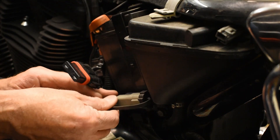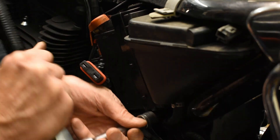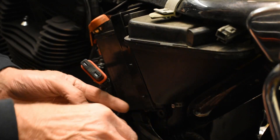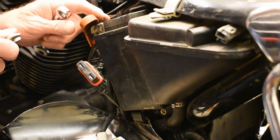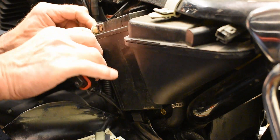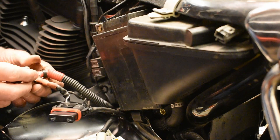And then unclip these things. I'm going to take this strap off, which is a 7/16ths. That just unclips from the top here. And then taking the positive terminal off, which is a 7/16ths — which is a 10mm. Very important that you don't touch any of the bike's earth when you're doing that. So that's okay. Now I'm going to just clip that up to stop it going walkabout.